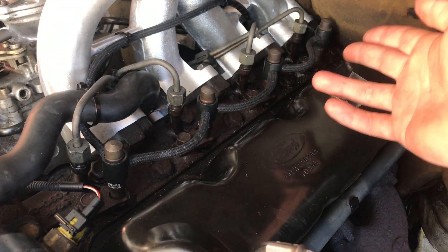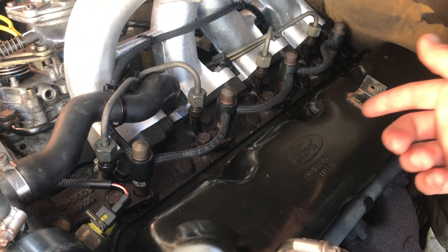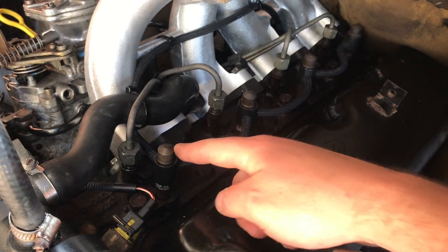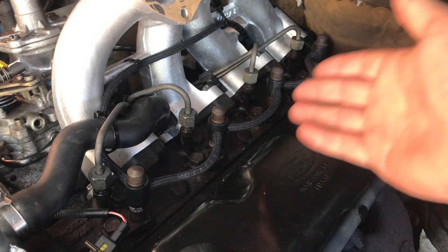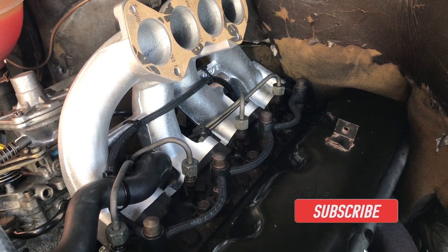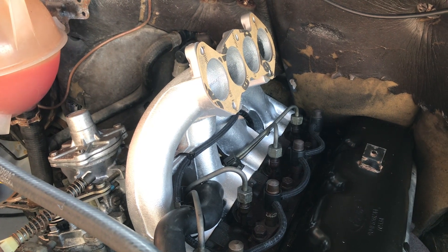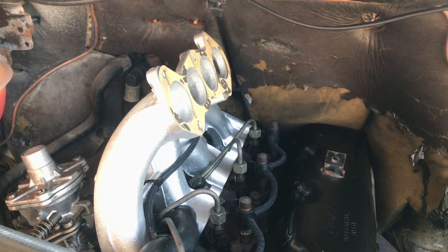For the sake of a few pounds for a bit of leak-off pipe and a blank, this is definitely worthwhile doing. We've got peace of mind that all the leak-off pipes are brand new, it looks much smarter, and we've done the leak-off mod so any air trapped in the system should be able to return back to the tank — we shouldn't have any misfiring problems. If it does continue to misfire then it must be something else, but at least we've confirmed it's not the leak-off pipes causing the problem. Thank you for watching — please like and subscribe if you enjoy the content, click the bell for notifications, and thank you to everybody already subscribed and supporting the channel.